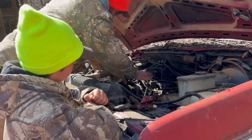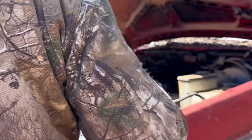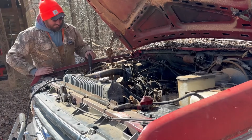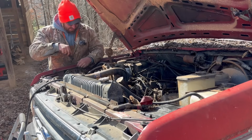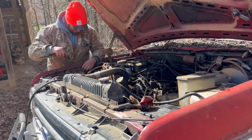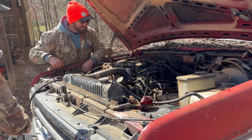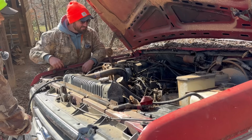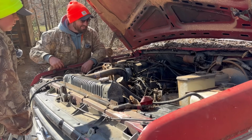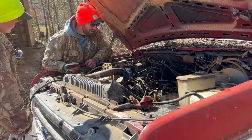All right. Let me run around there and turn the switch on. Well, the glow plug solenoid still works. I just heard it click. So that's a good sign. So now we're going to spin this engine over until I see fuel bubbling up out of every one of those lines. I ain't going to kill the starter. We'll let it. Oh, I got a leak right there.